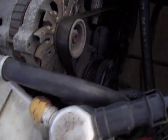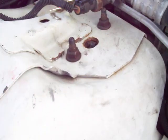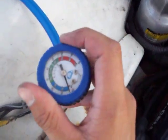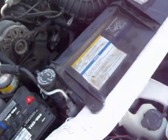Now I'm going to show you how to make your air conditioning ice cold. If your air conditioning is kind of warm but still has a little bit of chill to it, that probably means your compressor is kicked on but you might be a little low on coolant. You're going to want to get one of these adapter hoses right here — it's got a pressure gauge on the end and a quick connect. What you're going to want to do is start your car and turn the air on max so that everything is going at full speed and you can read the pressure.